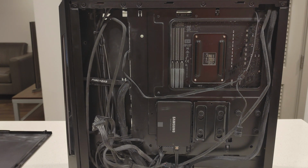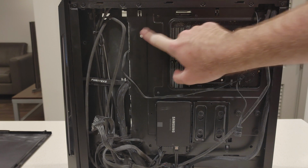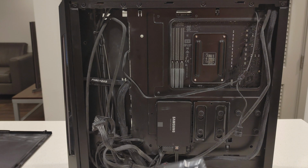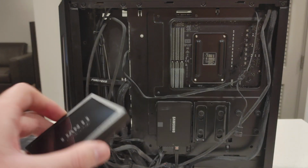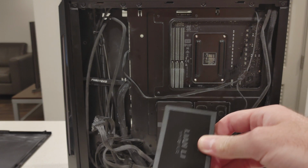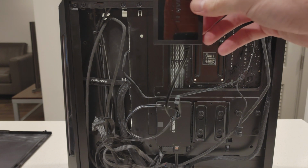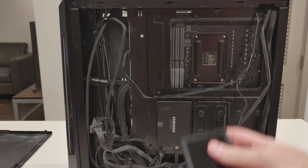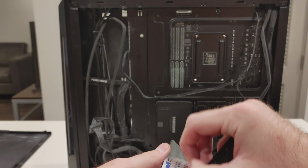So now the plan is to put the hub right here. I know the spacing isn't even, but it's my only chance. So let's take the wrapper off on both ends first. And then I'm going to mount it to where the SATA cable will be pointing downwards because the SATA power cables are closer that way. So let's take the padding off on one side first.